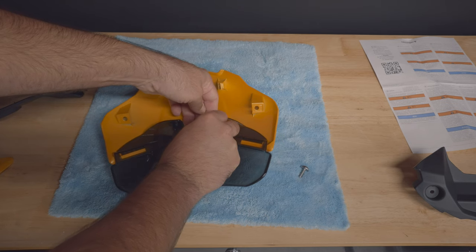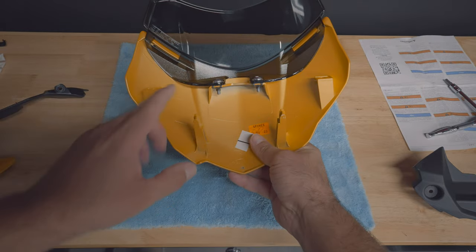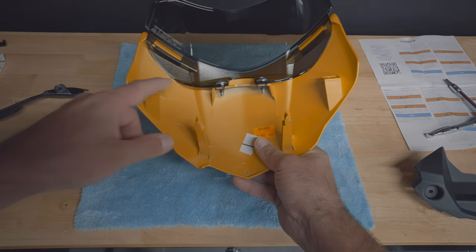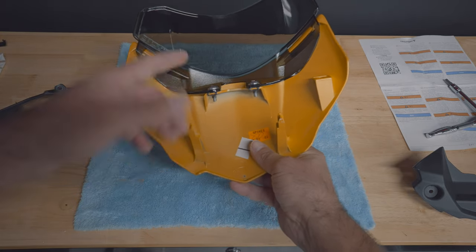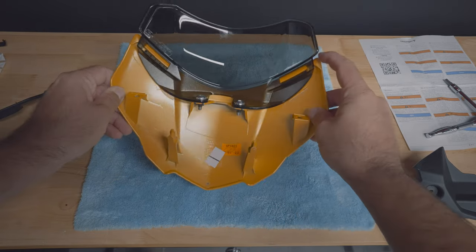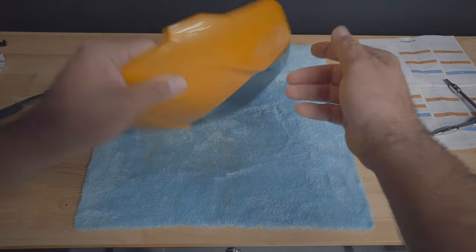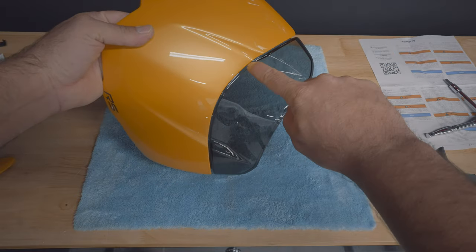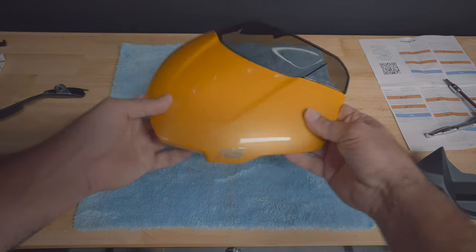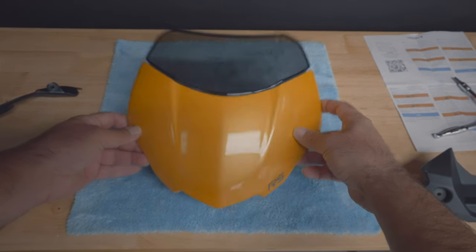Very simple process — just take the screws, slide them in place, and spin them. Triumph does give recommended torque specs, so don't over-tighten because you can crack the plastic or acrylic. The instructions say five Newton meters of torque, so use a small torque wrench and make sure it's accurate. What might surprise you is there's a little bit of a gap — from the photos I thought it would be perfectly flush, but there's actually a small gap all the way across, and that's totally fine, it's supposed to be that way. So don't be surprised. Here it is — this is the completed part. Now we put it on the bike.